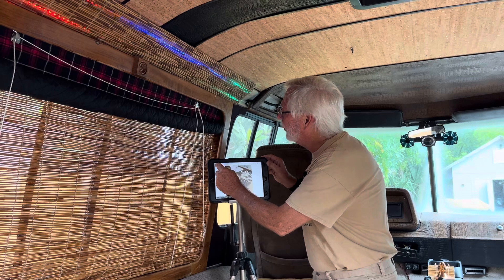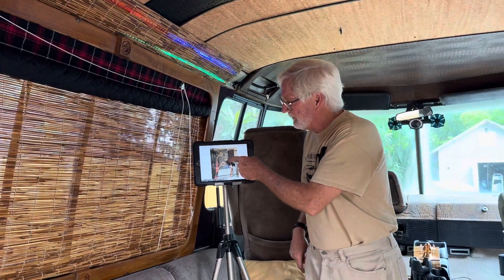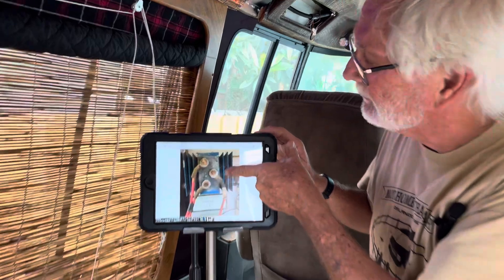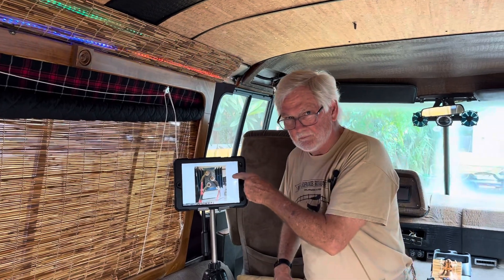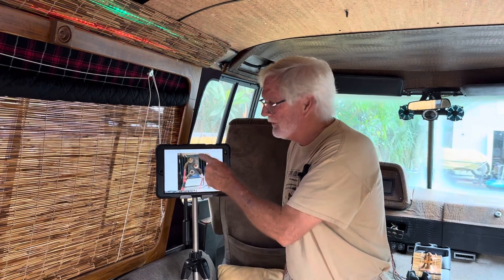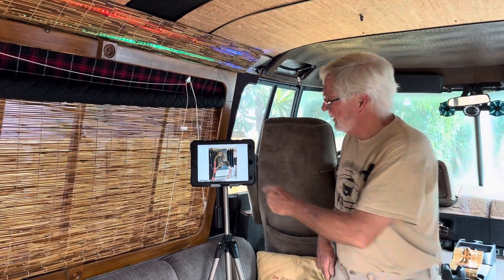Very important. When this happens to you — if you pick up a coach — first thing you want to do is have that voltmeter. These pictures will be at the bottom of the video. You want to check the center terminal on this battery isolator. There are three terminals on this blue fin thing, this battery isolator. With your engine running, check the center terminal. It comes right off the alternator, and if the alternator is not putting out, you will get zero volts right there. If you do get voltage, that means the isolator itself is bad. Usually they open up, sometimes they short out. With your engine running, you should have about 13.1 to 13.4, sometimes as high as 14 volts right there.